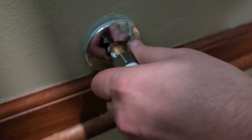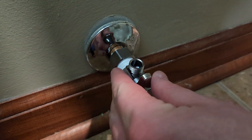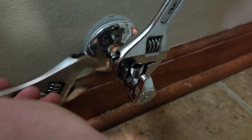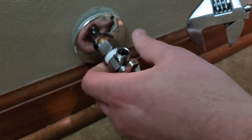When you start to feel a little bit of resistance from that copper ring, go ahead and get our crescent wrenches back out — doing the reverse of what we did last time to get it off. Make a bigger wrench in the back to give you some extra leverage. Start to feel some resistance from that copper ring, do another quarter turn, and a little extra for good measure. There we go, feels pretty secure on there.